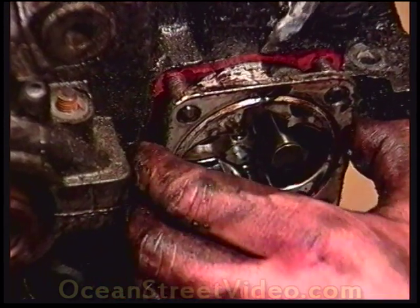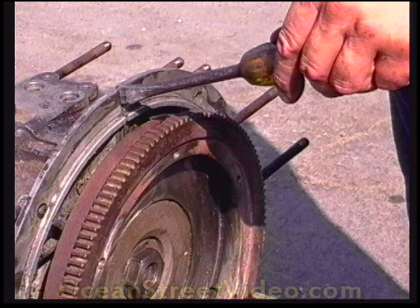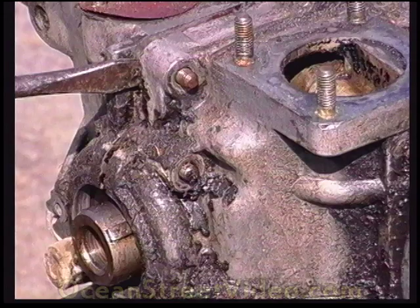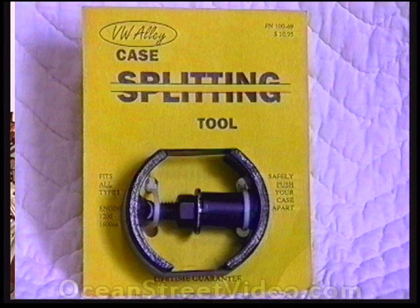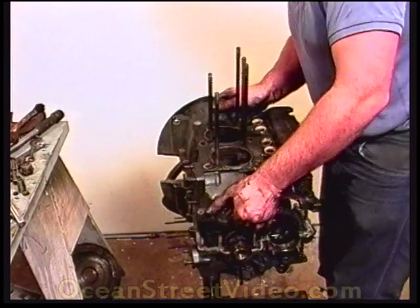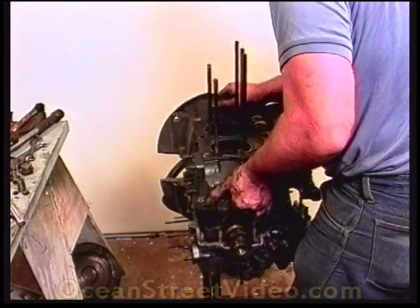You want to keep this main mating surface from being damaged. If you insist on prying the case apart with a screwdriver, do it at these places only. Be clear that any bumps you create on the case half mating surfaces are detrimental to both the seal and the operating strength of the assembled engine. Here is the proper tool for splitting the case without damaging the mating surfaces. If you want to recycle the lifters, then use lifter clips to keep them from falling out.